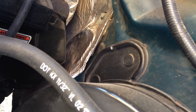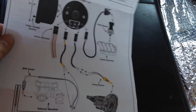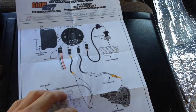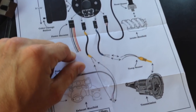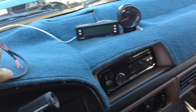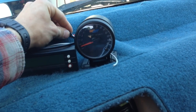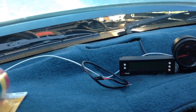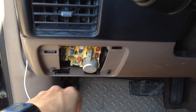If you take a look over here, you can see inside the engine bay that there is the other side of that black plate. If you have a manual transmission, you're going to have a clutch master cylinder there instead. This gauge cluster did come with this little instruction kit that tells us a little bit about where everything's supposed to go. The main one I'm concerned about is this power harness that has four wires coming out of it. I got just the regular standard harness and it's only about 12 inches long, yet I don't have any power sources readily within 12 inches. So this power harness is going to plug into the back of the gauge, meaning we need to extend the wires all the way to our power source, which I'm looking at pulling from the fuse block right underneath the dash.